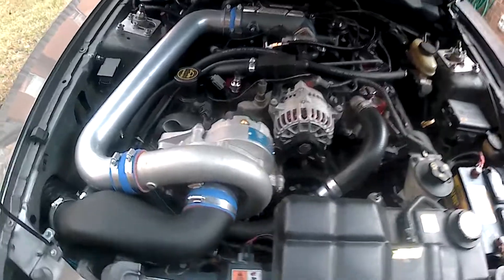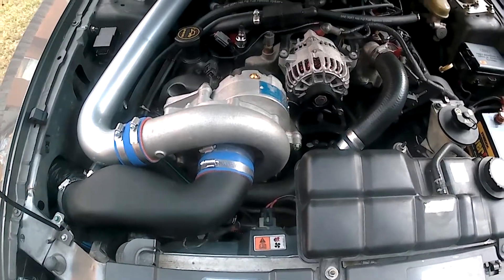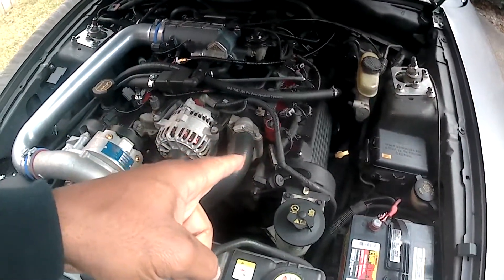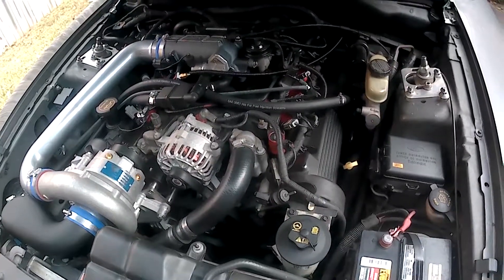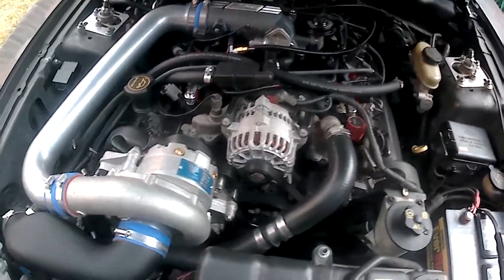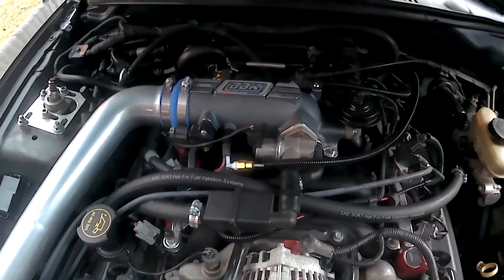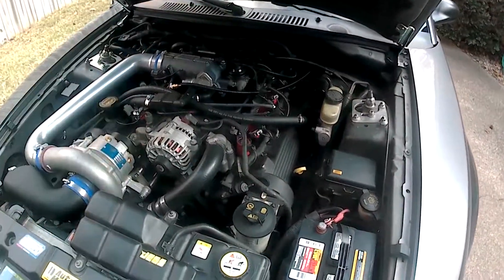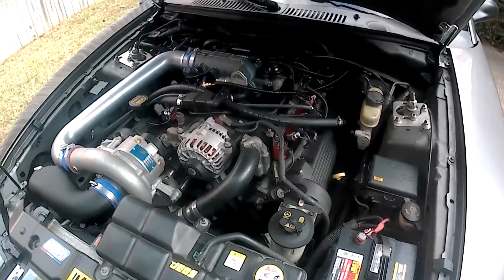As you guys can see, we've got a pretty clean installation. They did a good job with the kit as far as fitment. Before we dive too far into this, I want to tell you I did start out with some additions: I put new plugs in — those are NGKs, I'll list the exact number in the description. I did upgrade the fuel injectors to 60-pound injectors. I also added a 78mm BBK throttle body. In the back, we upgraded the fuel pump — I thought it was a good idea to have a high-performance fuel pump going in, knowing I was going to do this modification.